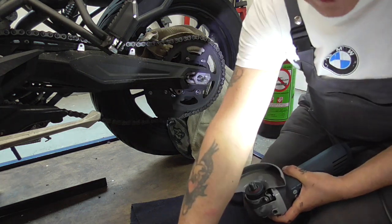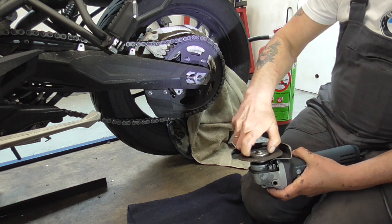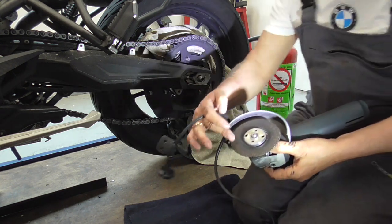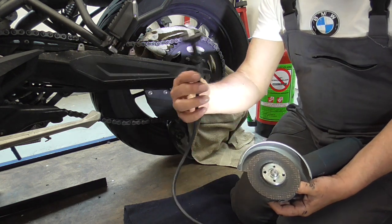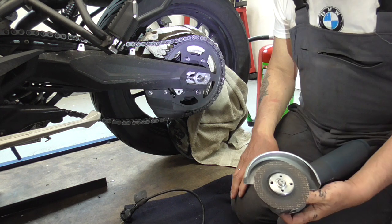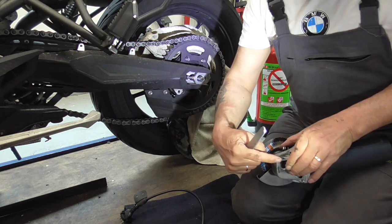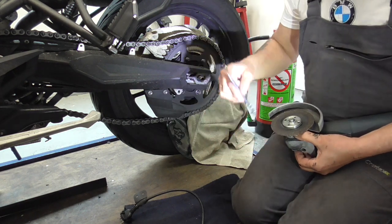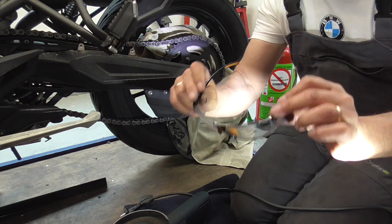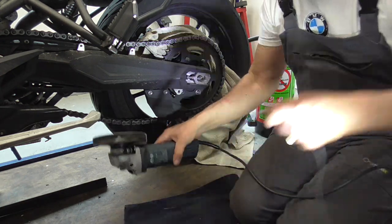So, got my angle grinder. What I always do when replacing the grinding disc is have it out of the socket, because you never know when tightening it that you push the machine on. Then, over here is a button you have to push to lock the machine. Okay, now it's good. Then use safety goggles. Okay, ear protection. Okay, check. Then pop, pop, pop.